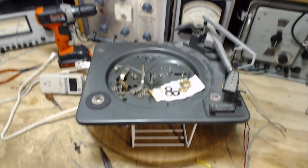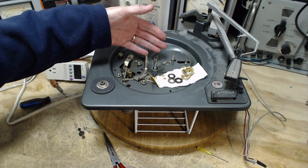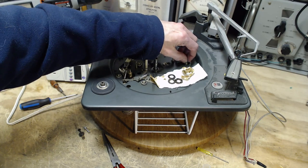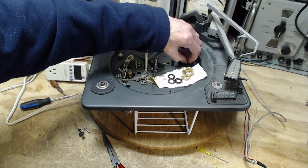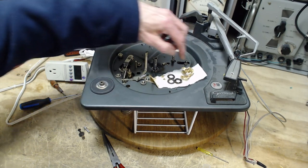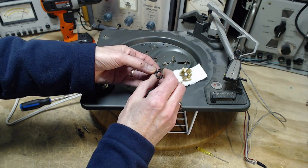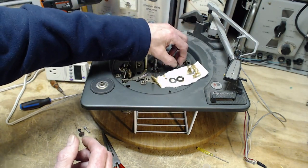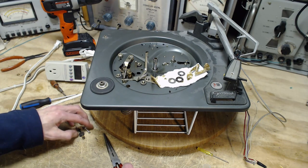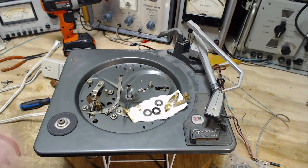What I need to do is clean away the oil and reassemble this — I'll do the cleaning off camera. I'm going to use alcohol and WD-40 to clean, especially here, and stick a little alcohol down in here. You can't get this little wheel off and there's no reason to, but you do want to get some new lubricant into it, or at the very least wake up the old stuff. This is actually not so bad. To clean this out, you need a little tool to pick out the old lubricant as much as you can. Bicycle bearing lubricant or all kinds of greases would work. I'll be using silicone grease — it's probably the better choice because it doesn't age.